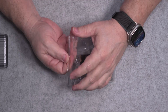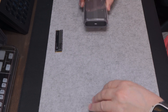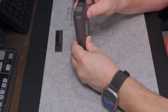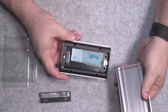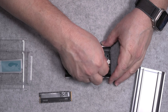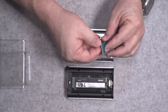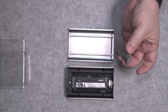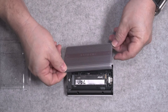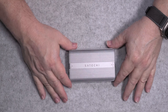Once we get that open and take it out — may not need the screw that it comes with. I've taken the polycarbonate casing off just to see what it feels like. It is very solid and has a good heft to it. Once we open it up, we see that it does have a silicon cooling pad in there as well. Let's go ahead and get the NVMe in there — push it in, and there's a little nub that just twists. Remove the plastic from the silicon cooling pad and place it on the upper case, right above where the NVMe is. Peel off the other side of plastic and close up the case — be sure to pay attention to which side has the latch.